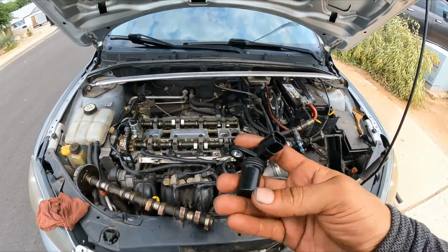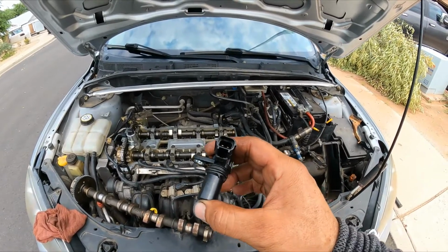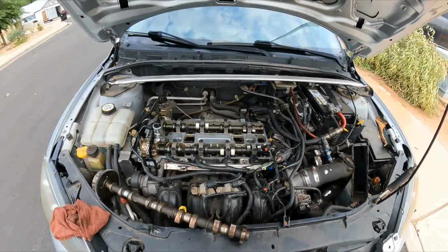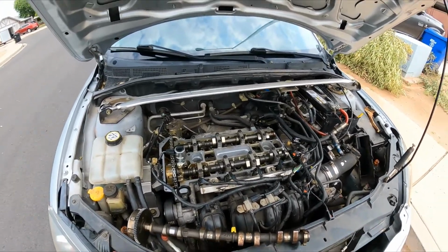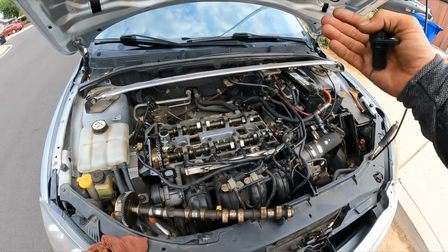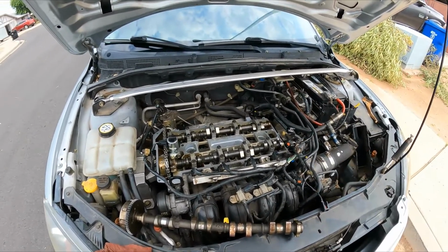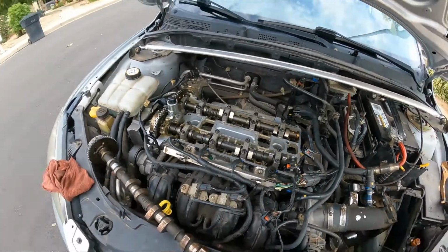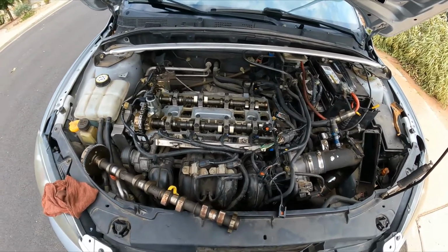Anyhow, on this vehicle the camshaft sensor has been replaced multiple times. The pigtail was replaced multiple times. The wire harness checks fine, the waveform checks fine, it triggers and all that stuff. And the only code is camshaft.